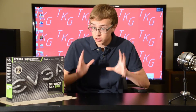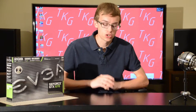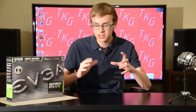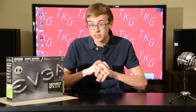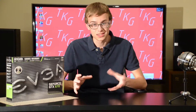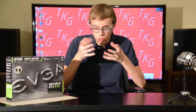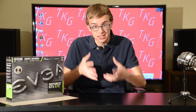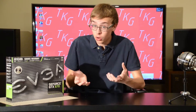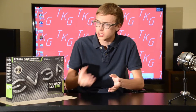It's the same GPU used in the GTX 680, just with a few cores disabled. The main reason for that is the GTX 680 with its 1536 CUDA cores — the 28nm process makes that a bit difficult to get perfect. So the ones that aren't perfect, the cores that are messed up, are simply disabled, and then they put them into GTX 670s. And they're perfectly working cores, but they just have a few less CUDA cores.